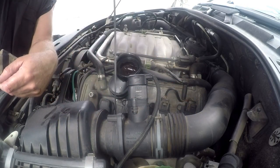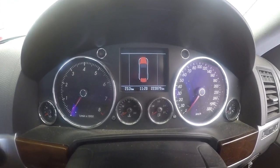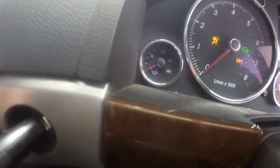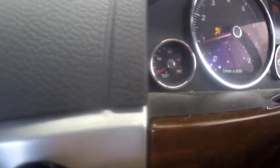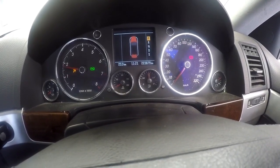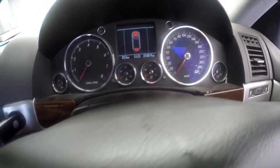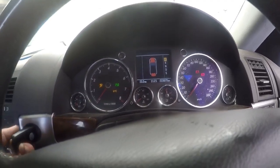This ProLong is 500ml, so that's going to account for 500ml of the volume. Another two litres going in. Let's check the dipstick once more — we're on our maximum mark at six and a half litres. Bearing in mind we still have to start the vehicle. I'll put the oil filler cap back and get the car started. We'll get the ignition turned on — I don't see any oil light, but we'll watch the oil pressure. No unusual noises on the car, no oil light warnings.